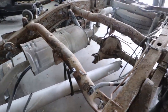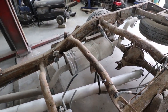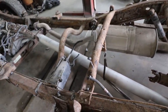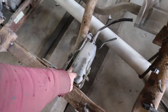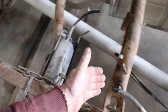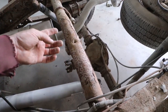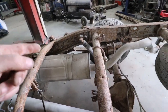I don't know what size of yoke or anything the other one uses. And I know lots of people had lots of ideas for the fuel tank, but I don't have to move this very much, so I'm not too worried. If anything, all I gotta do is move this bracket ahead, because I'm not using any of the EVAP. This will give me plenty of room. So I'll remove this and move this ahead, and essentially this cross brace has to move ahead anyways to fix the shock. So I move this ahead, fuel tank bolts down like stock, no big deal.